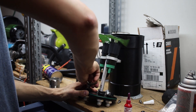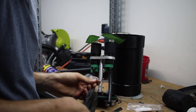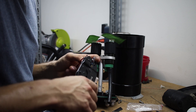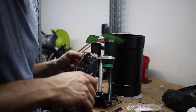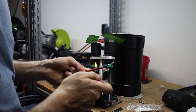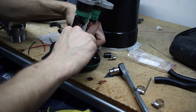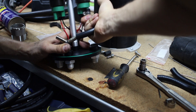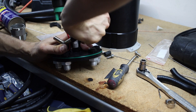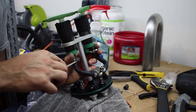You can do some pretty detrimental damage to your motor. The second benefit is you can have up to three fuel pumps in a surge tank. If you constantly run a very large fuel pump and it's continuously circulating through the car and the fuel rail, you're going to heat up that fuel a lot — and it actually changes the detonation properties of the fuel you're trying to ignite. The injected fuel can get too hot and lean out the motor. So in this system, I have one pump that continuously runs and feeds the engine 99% of the time, but if I go over a certain throttle position, my ECU sees that and kicks on the second fuel pump — so I'll have enough fuel when I need it, but when I don't need it, I won't be cooking the fuel.